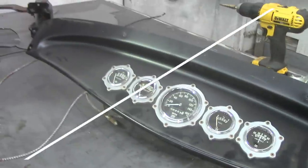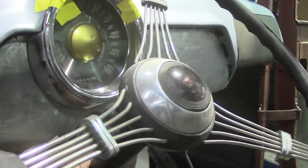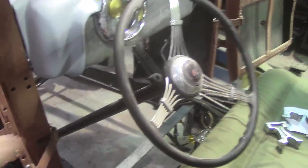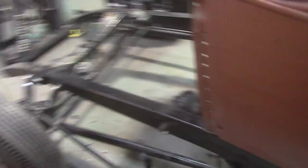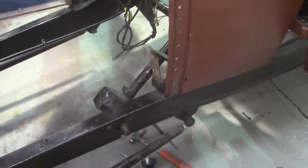I got the column in here. It's lining up with the opening no problem, but it's way too close to the gauges. What I want to do is drop it down. I'm not going to be running this wheel either — this is a 17-inch wheel and I'm going to put a 14 or 15-inch wheel on there, probably 14. The car is already easy enough to steer and it's nice to have the leg room. I need to reposition the mounting of the steering column drop and I'm going to have to change a couple of holes in the frame just slightly.